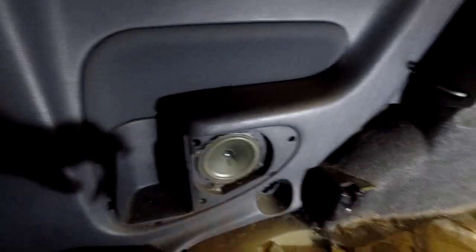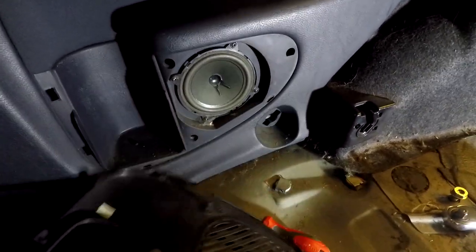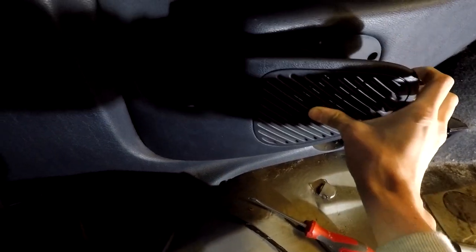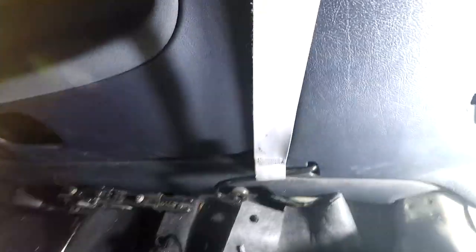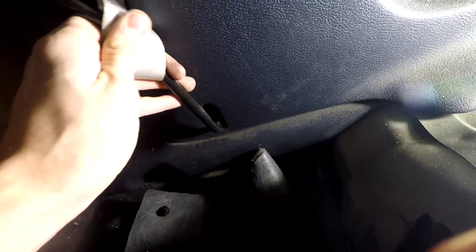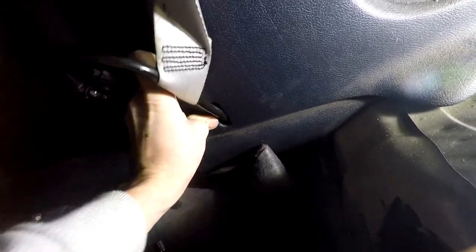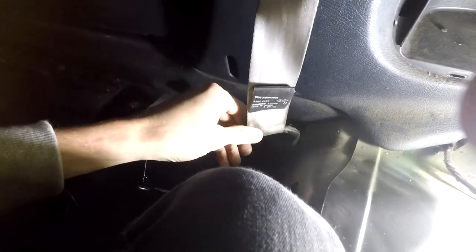I've taken out two T15s and pulled this panel off. That's obviously to cover the speaker. I've taken the bolt out that was there with the socket - a 17mm socket to take that off. You obviously got to pull this off first because the speaker's attached and all wired up behind. So pull this side, these pop out, and then this side should lift through just because on the back you have the catchers that hook round. So obviously try not to pull that side out because that will snap them. The rest of these ones pop out - pull from the right to the left. I've undone it with the T40 bit, and then you just lift up because there's like a hook that goes in, and you should be able to pull and it will pop out. Then obviously put it back in, push it back through - it's kind of like a squidgy thing on the other side - and then you lift it back down to reinsert it. And then that one's loose - I'll keep them together for now.